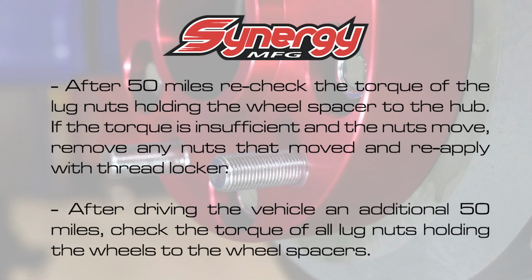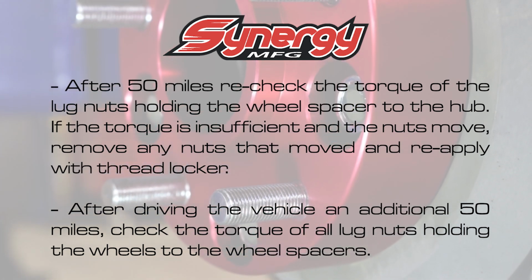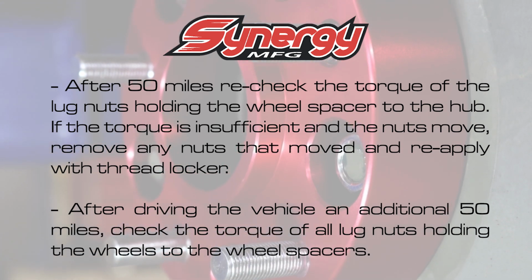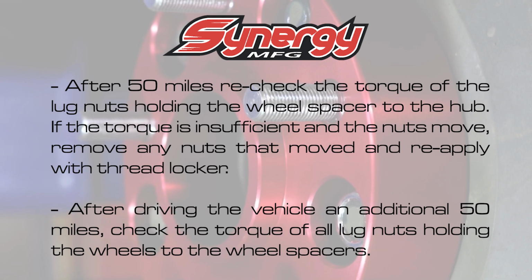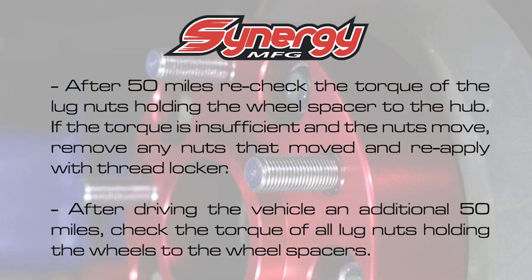After driving the vehicle approximately 50 miles, recheck the torque of the lug nuts holding the wheel spacer to the hub. If the torque is insufficient and the nuts move, remove any nuts that moved and reapply thread locker. After driving the vehicle an additional 50 miles, check the torque of all lug nuts holding the wheels to the wheel spacers.